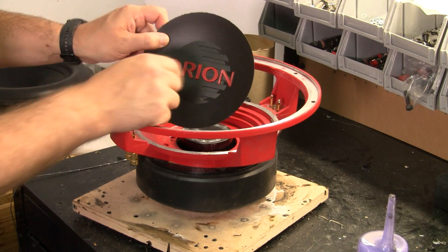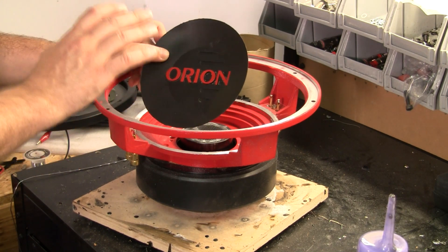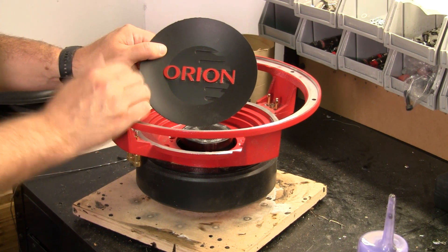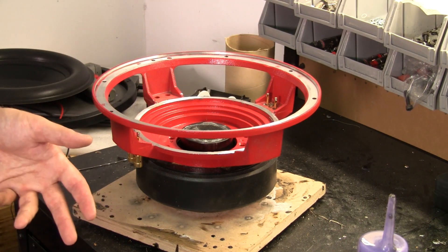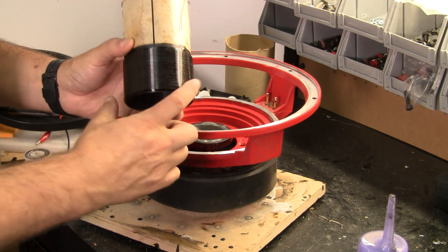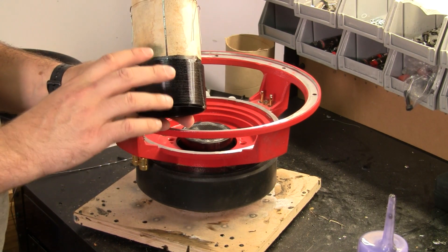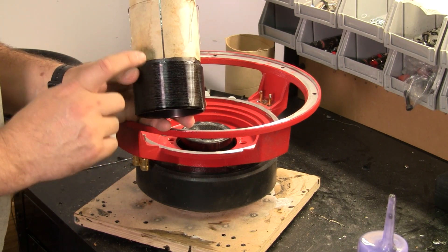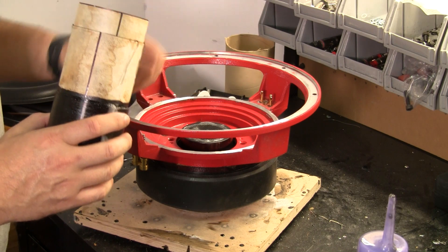This dust cap did have a crack in it but I've repaired that, so it should not give us a problem. We're going to maintain a factory look very close — a few differences like spider color and surround material, but basically like new but better. Another upgrade is the coil: it has a little bit longer winding length and slightly larger outside diameter, so we should have just a little bit more BL and more X-Max — a little stronger, a little louder, and definitely more reliable because this is an American-made coil, just like the original.